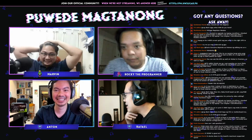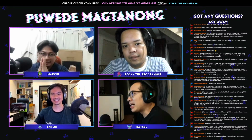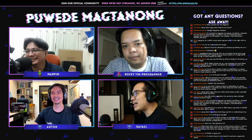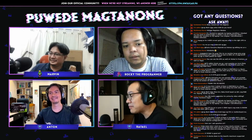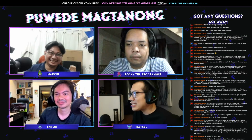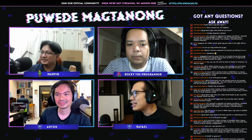To summarize the panel, it's possible that it's not your graphics card that is burning up. But in the unlikely chance that it really is your graphics card, you should swap it out and try a different graphics card to see if that one would also burn up. Because if you're going through graphics cards, that means there's something else wrong. Must be the motherboard, or most probably the power supply unit. Especially if your power supply unit is not branded. What's the term again?